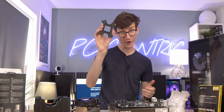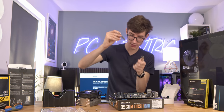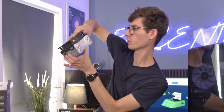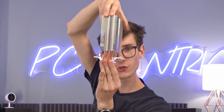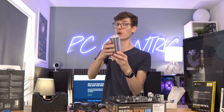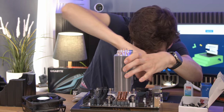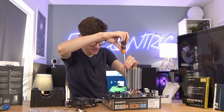Let's take the Hyper 212 Evo V2 out of the box — just a little bit more substantial than the stock cooler. Grab the back plate, lift up the motherboard and feed it through. Get the little post things and screw them into the board, then grab the little metal brackets and place them on top and secure those in with the screws. Remove the fan from the heatsink, grab your thermal compound — Master Gel Pro — and make a little line on the CPU. Note that the cooler is asymmetrical so that when you put the fan on it's further away from your RAM, so line this up so it's leaning more to the left.